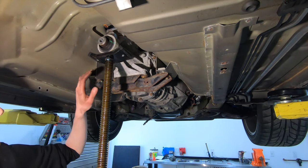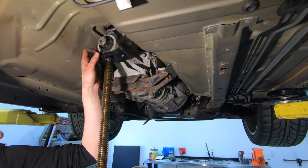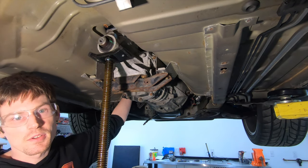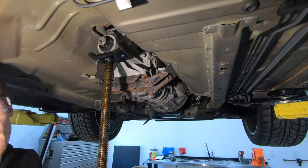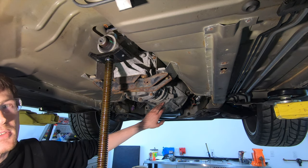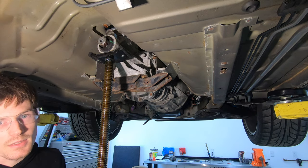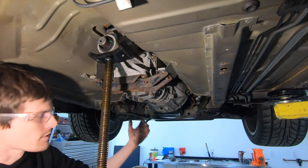Now we're actually going to start removing the transmission. I got my floor jack under the tail shaft so I can unbolt the transmission crossmember. To reach the top bolts on a 4.6-liter car, you'll have to slowly lower the tail shaft so the transmission drops enough to get a long extension to the top two bell housing bolts. On the T45 and 3650, the bolts are on the inside of the bell housing going from the bell housing side into the transmission, so you have to drop it all in one piece.